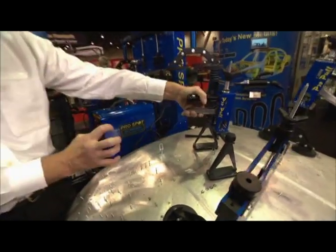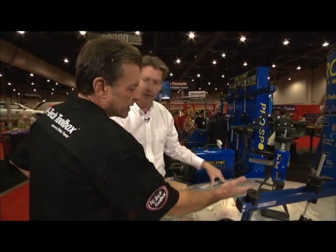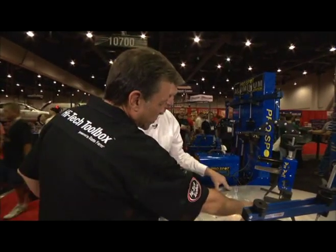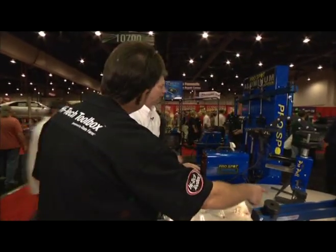This system lets me actually freeze the pull right here. That's so cool, because you never really get it pulled right to where you need it — your hand keeps going in and out. This way it locks in right where you want it, and the technician can use one of these aluminum hammers to start working the area around the dent.